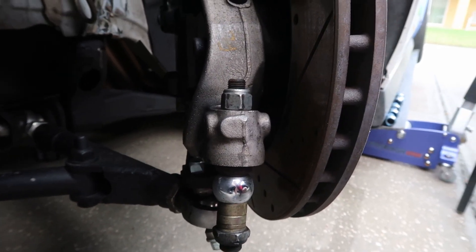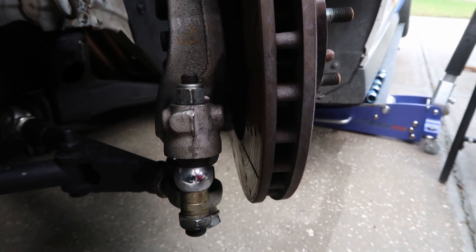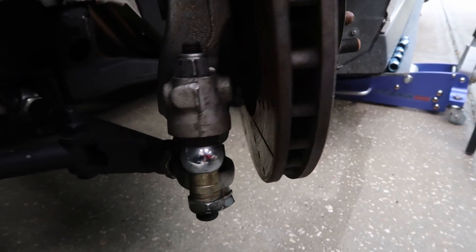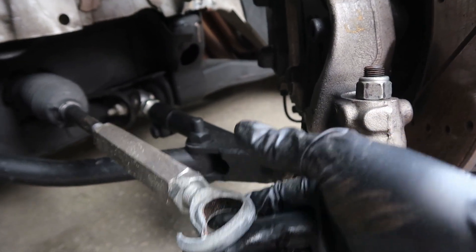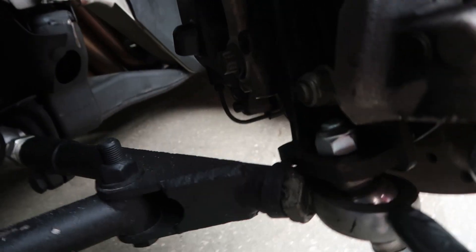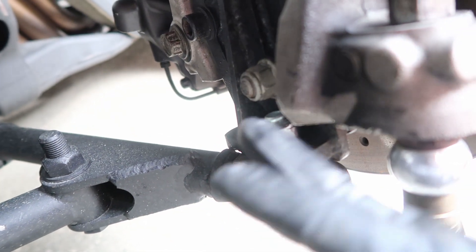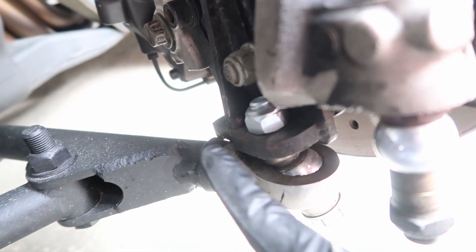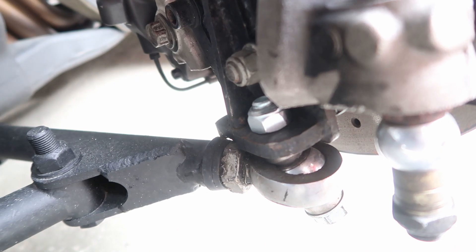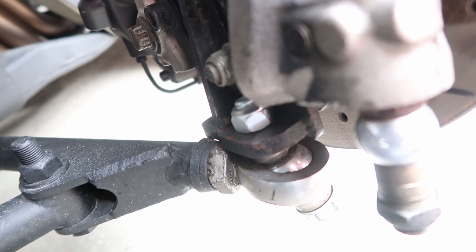So essentially what was happening was, as I was turning the wheel there would be a little bit of play, and then — right there — play, play, and then that is stuck. I have to put a substantial amount of more force in order to turn it. So yeah, a lot went wrong. But at the end of the day the only thing that broke was this. I already ordered new heim joints, so I just need to replace those. I also want to try to get more angle out of this because you'll notice the knuckle bracket is hitting the lower control arm. I have a couple of ideas to get a little more angle out of this kit. I'm going to reach out to Ricky Sellers — he's a fabricator in Daytona Beach — and bring this knuckle to him to see if he can do some modifications to get us a little more steering angle.